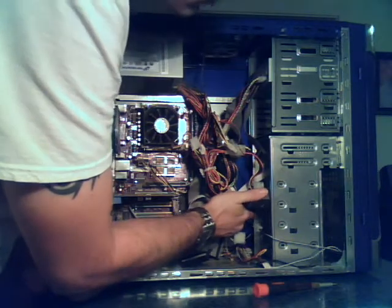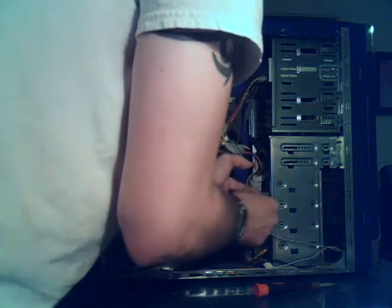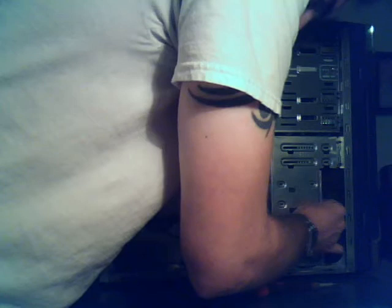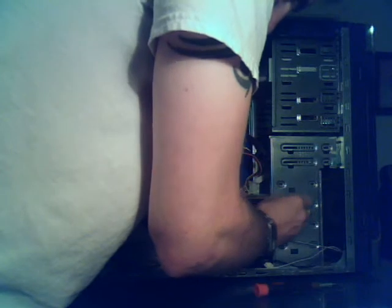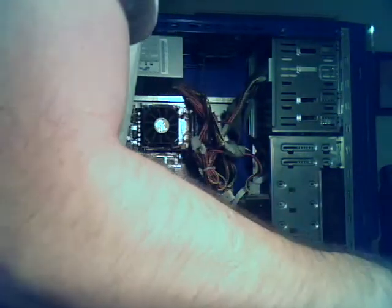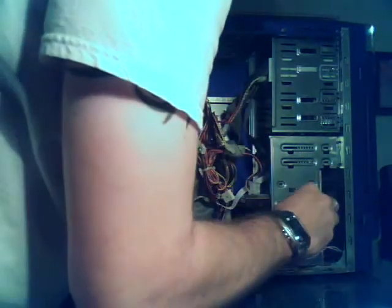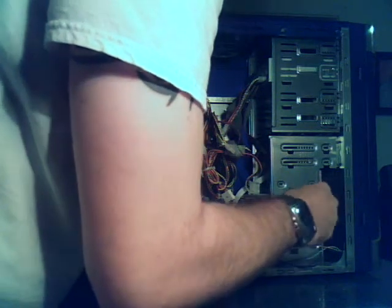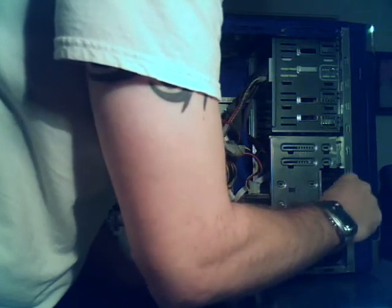Be careful when putting the drive in, because the moment you take your finger off it, it can move around and knock against something, causing even more damage to your drive. Make sure it's fixed in there good. If you have a solid state drive, you don't have to worry about that because there are no actual moving parts — it basically looks like a giant RAM module with a bunch of little chips. But traditional hard drives have lots of moving parts and they can get screwed up pretty easily. All hard drives will fail eventually, so it's good to get in the habit of backing up your data.